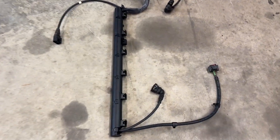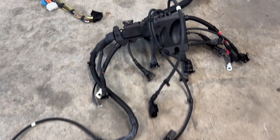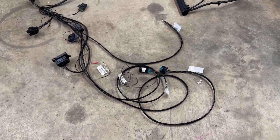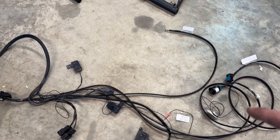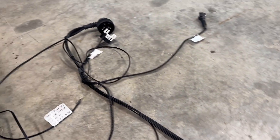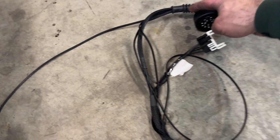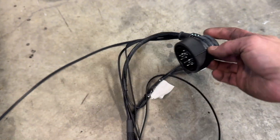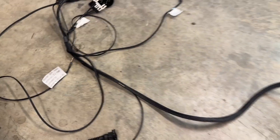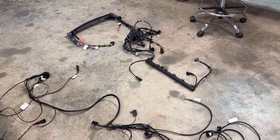Now let's take a look at the wiring harness. We've got a brand new factory S54 wiring harness — basically an S54 wiring harness for engine swap. It's got your sport button, it's got your accelerator pedal, it's got your grounds and your powers. It's got your X6004 here, it's got the OBD connector, and of course it's got your C101, which is what it is for the E30. It's got basically everything we need: coolant temperature sensor, oil temp, all that cool stuff. And we are going to install that right now.